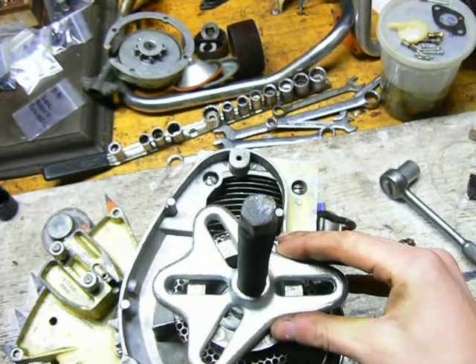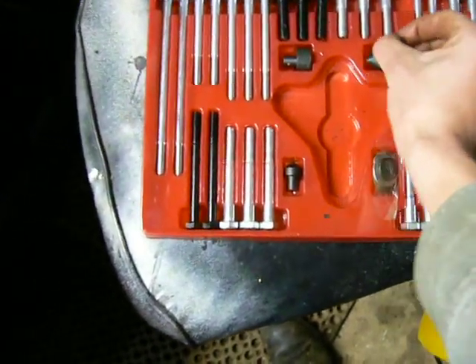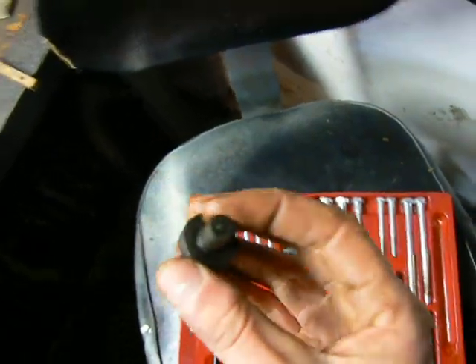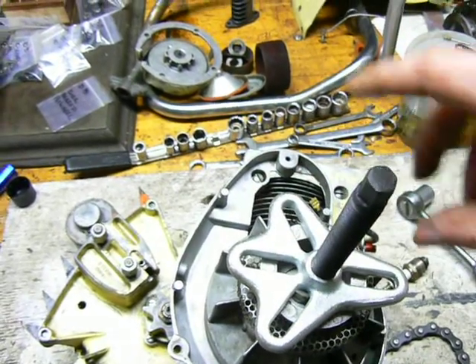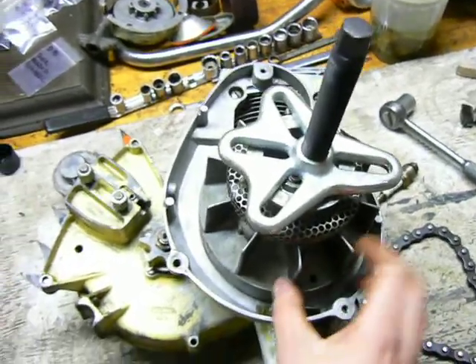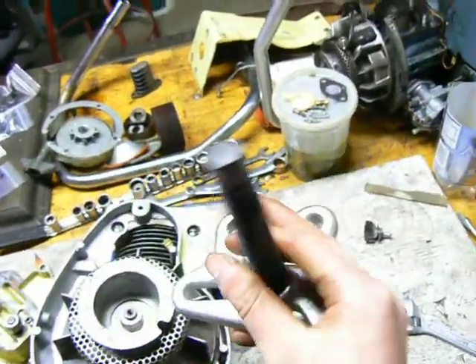You set this up without the starter cup in the way, select the proper bolts — there are all different lengths and thread sizes. The center piece slides into the end of the big screw. Then you run the two or three bolts in there and crank down on this until it tightens up against the bolts. Make sure to thread the bolts very deeply into the flywheel because it's just aluminum. Then, again, take your hammer and give it a whack, and it should pop right off. This is a very handy thing; I've used it a number of times and don't know what I would have done without it.